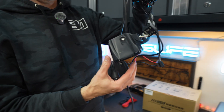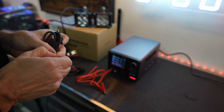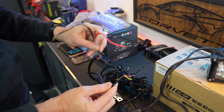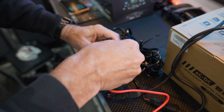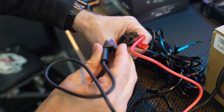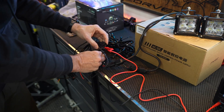First up, let's test a pair of LED light pods. Normally I'd grab a 12-volt battery to do this, but now I can dial in exactly 12 volts on the IPS3608. We have our lights and harness, which has a relay as well as a provision for a switch. We're going to bypass the relay so we can connect right to the wiring that feeds the lights. These are pretty nice alligator clips — just making sure I have a good connection. The relay is bypassed.